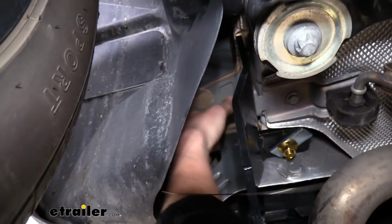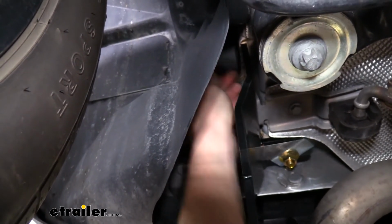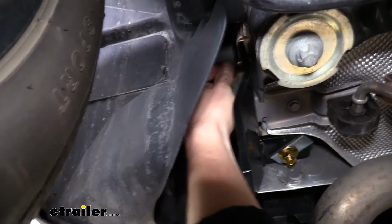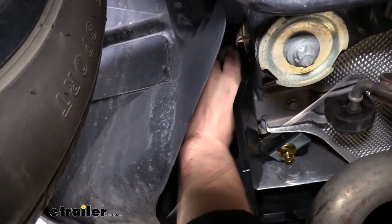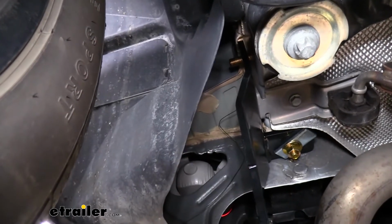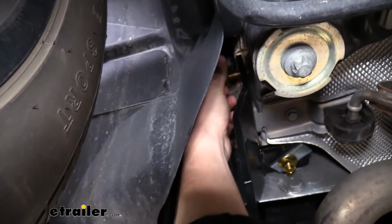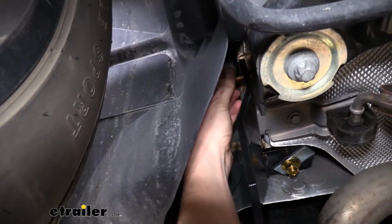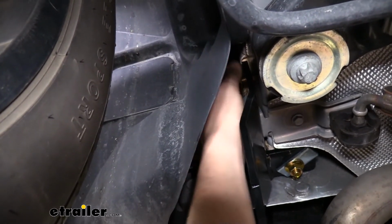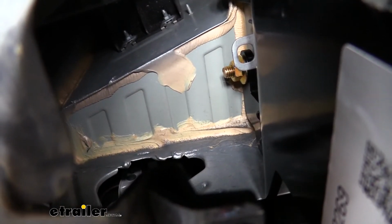Now we can reach up in here and pull our fish wires to where our side bolts come through, just like that. We're going to do that with both of them. And once you've got those slid through, you can just pull off your coiled wire and then thread on a flange nut. You want to be careful not to push the bolts back into the frame because they can be difficult to get back through at this point. And then we'll do the same thing over on the other side.